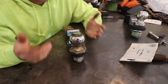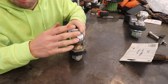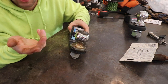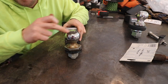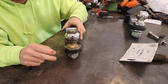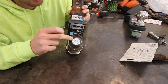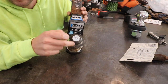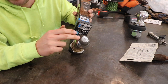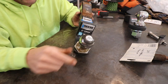Let's talk about the cheap ball. It's rated for 7,500 pounds, one-inch shank, chrome plated. The problem with chrome plating is it will wear down over time, especially with heavy use, and that exposes the mild steel underneath. These balls are significantly cheaper to manufacture, but after the chrome plating wears down and the mild steel is exposed, it will pit and corrode over time. You'll find yourself replacing it, and it's going to look really ugly — especially if you're not putting any grease on the ball. It's going to be a big rusty mess. You get what you pay for.